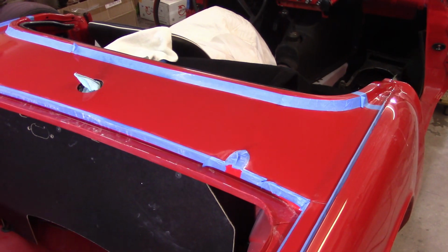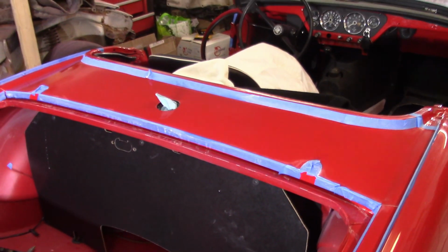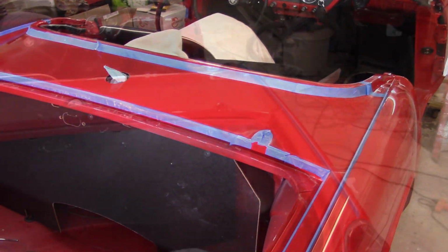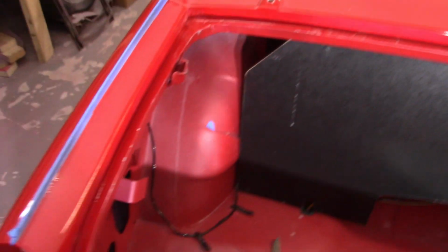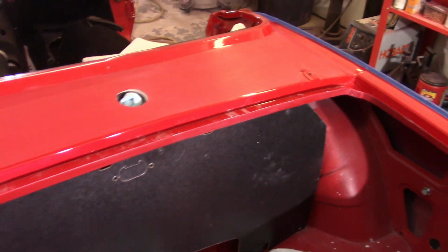The next up is 2000. I got that ready to go down here. I'm gonna try to use, again, both the block and the orbital and just try to get all those 1500 scratches out. 2000's done. I pulled all the tape off of the edges in preparation for doing the 3000